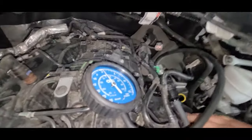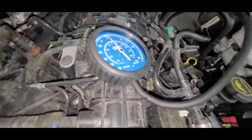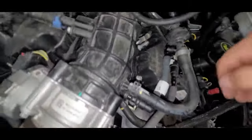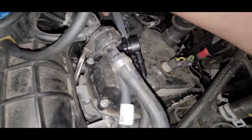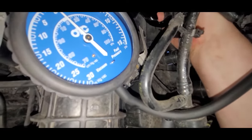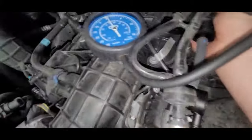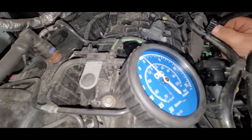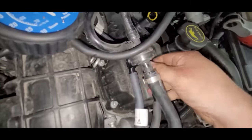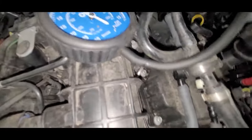I'm going to remove the rubber connectors here. Now we're just going to fit the purge valve assembly back into place. I find it easiest just to do the connector on the intake first, and then connect our rear. Make sure we're all the way seated. Lock it in. Reconnect our connector. Put that final piece on. Put our 8mm back in.